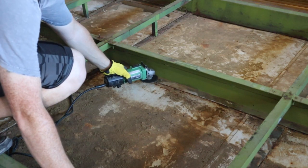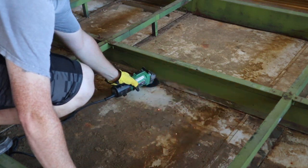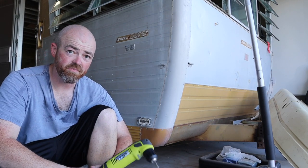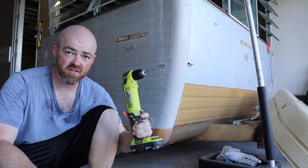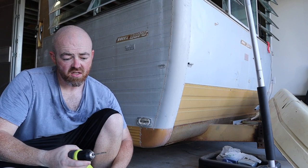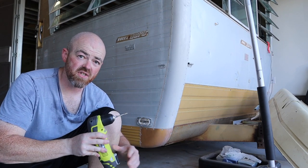One of the primary reasons I vacuumed everything out — hopefully I'm not going to start any fires. The second thing is I've got a lot of Ryobi tools, sponsored by them. Never had a need for one of these. Had to go pick this one up with the shortest drill bit I could find so I can get underneath the trailer. The problem is there are a lot of rivets that go into the main frame, and because it is a full channel frame, there's no way to get to those rivets from the inside. So the primary frame on both sides I'm going to have to reach underneath and drill every single rivet out with this. Hence why I was not looking forward to this day.